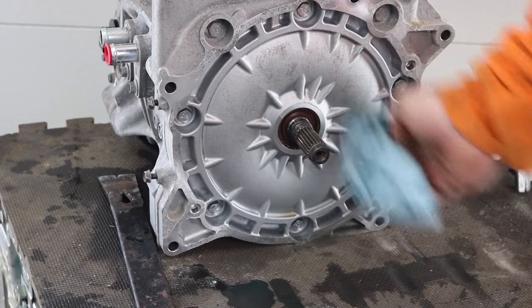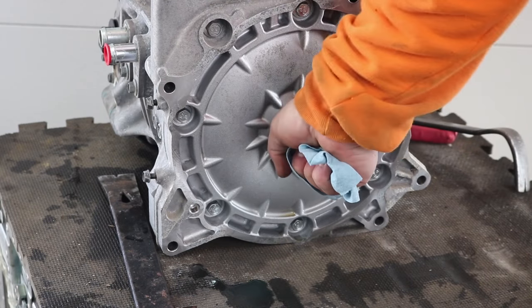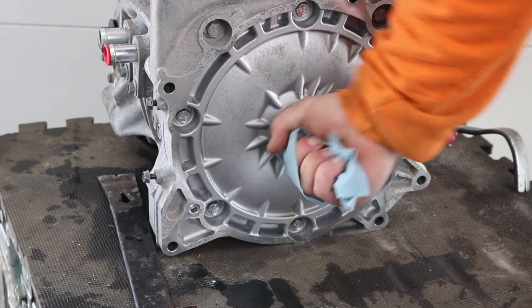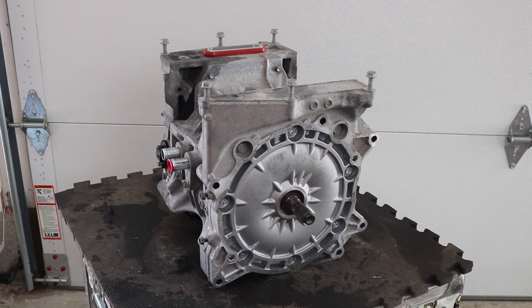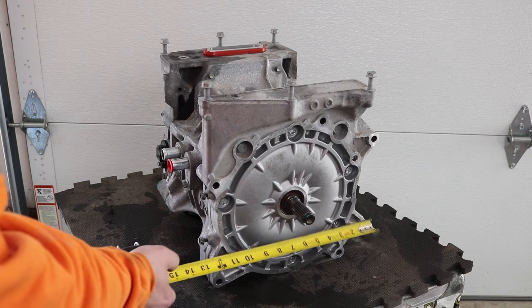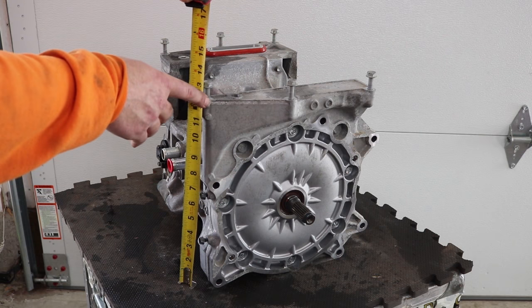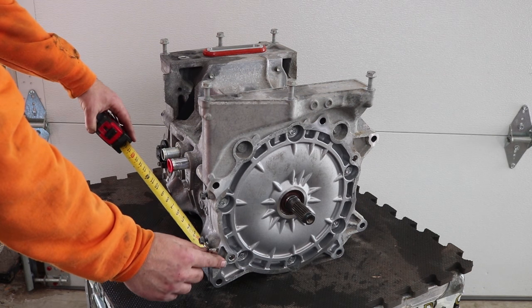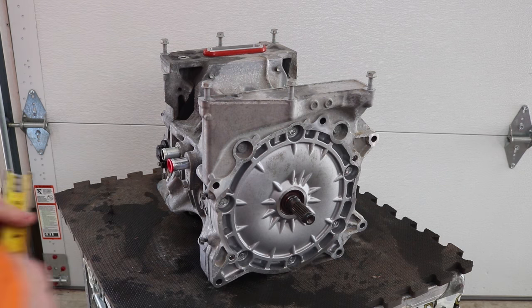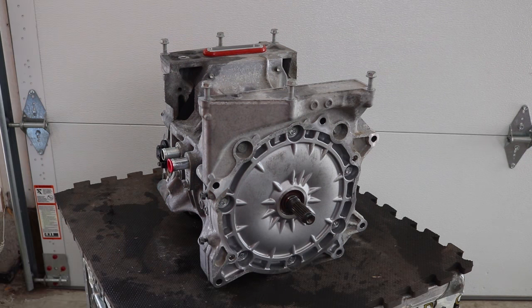There's our so-called transmission — single speed gear reduction. And there's our electric motor. Always amazing how clean these things are; there's just a little bit of grease on there that was used to connect it to the gearbox. I can wipe that off and spin this by hand — spins nicely. I can feel that it's a permanent magnet motor; I can kind of feel it snap into place where the permanent magnets are. Pretty cool little motor. Here we have the motor all by itself. Frankly, it's not that big — measuring across it's about 12 inches, about 12 and a half inches high. It's actually skinnier in the middle, and it's about a foot long. The shaft itself is about 2 and a quarter inches.